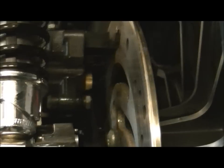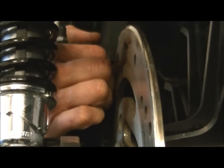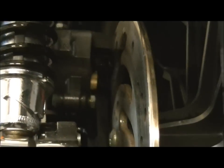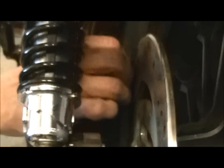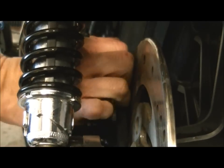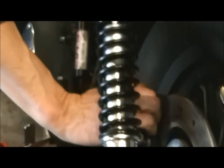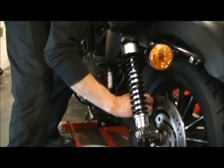Right, and just for a second, get the brake cleaner again. Clean all that off. And you can see in there straight away that's nice and shiny. But what I want to ensure now is that the piston is moving nicely by hand. You'll feel it straight away. Get your fingers on the inside of it and just squeeze the caliper and you'll feel it move back. Then reach over to your brake pedal and pump it out. Careful not to trap your fingers. Okay, I'll push it back.